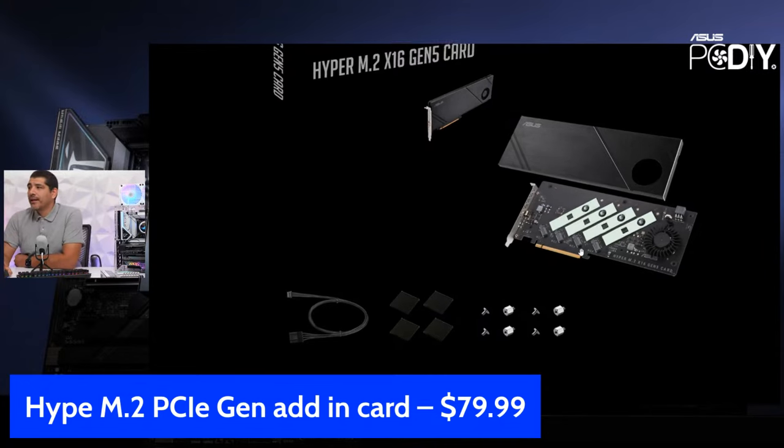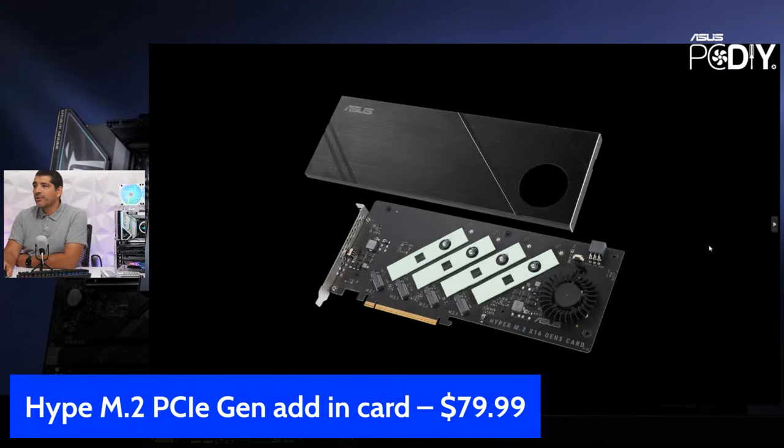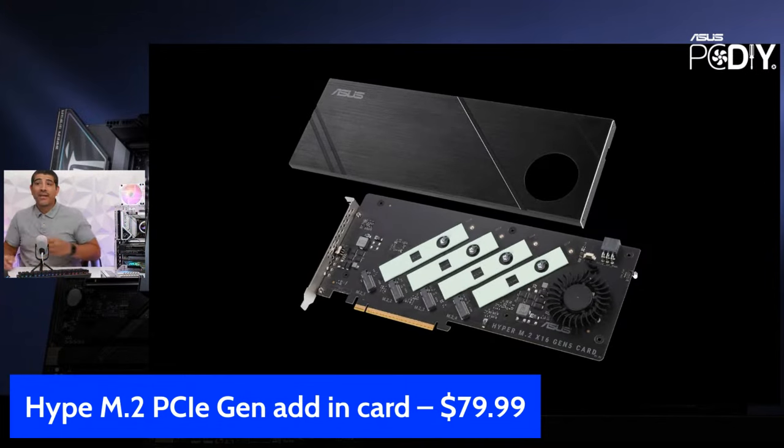So again, this card will be introducing PCIe Gen 5 support. It will also include the dual-sided contacts for improved thermal dissipation performance. It will also include the Q-latch design. And also, something you may not be aware of is that we have had really great reliability and feedback from users that have utilized our cards compared to, let's say, the no-brand solutions that are out there. And part of that is because we have a much more stringent tolerance for our PCB design. We use a server-grade, low-loss PCB design here that allows the signal integrity performance to be very good.